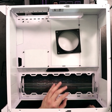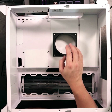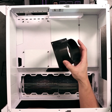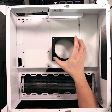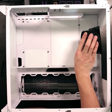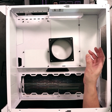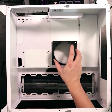And yeah, ducts. These are staying for sure. I just don't know if I'm getting 4 of these 4-inch ones, or 4-inch ones and 2 5-inch ones. I can't duct both sides with 5 inches because it cones outwards. You'll see these on Amazon. Just look up 120 millimeter duct. It's meant for those Antminer mining machines. They have a 4-inch one, they have a 5-inch one, but 5 inches is more than 120 millimeters, so it bulges out. So I can only do one side like that. If the Ice Giant is the same height as this, coincidentally, after it's mounted, fan, duct, then I can get straight pipes, and it would be a 5-inch here and a 4-inch here. That would be awesome. But they don't make the 5-inch ones that are offset.